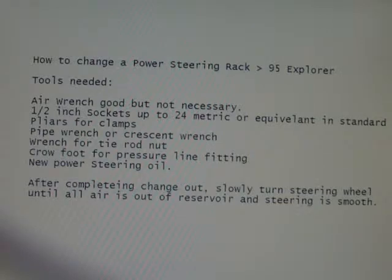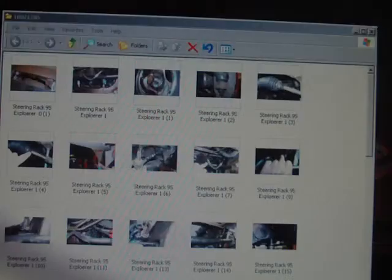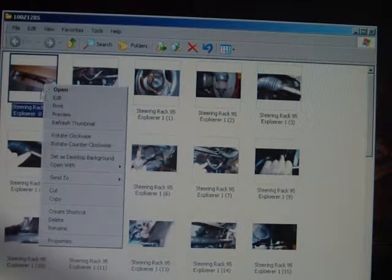And if you look at the power steering oil, you'll find that it can be black as well. Of course, another telltale sign is if you crawl underneath and look at your steering rack, you'll find that there's oil dripping and sweating and it's quite dirty underneath, and that'll tell you that your power steering rack needs to be fixed up.